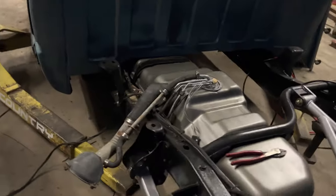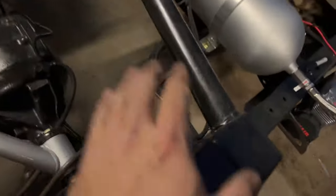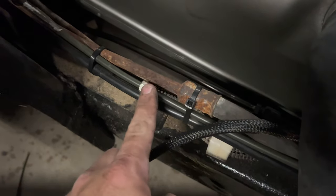Just out here killing these brake lines, getting them bent all up with the notch, and run up here where I had to flare that. Got to the last bend, I was like, yeah, and then realized my freaking nut is still at the front of the line. That's a tear. I'm just going to go buy a new brake line and start over because screw flaring another one.